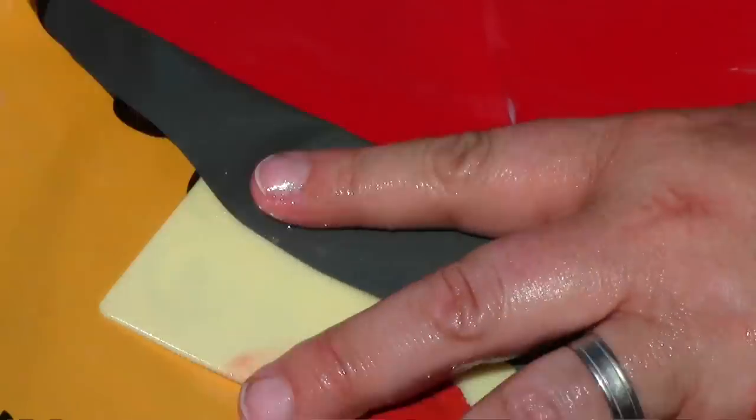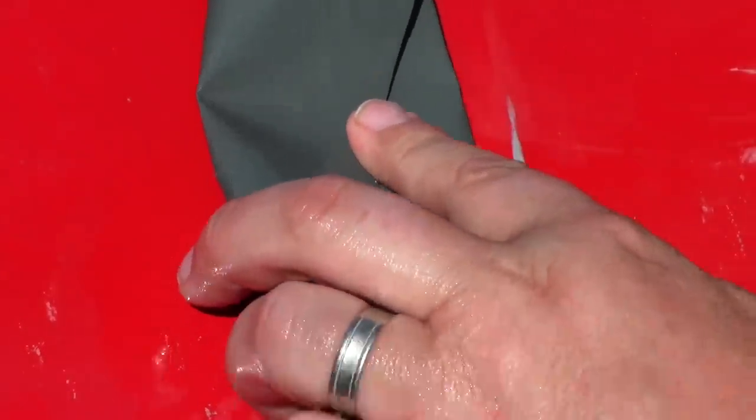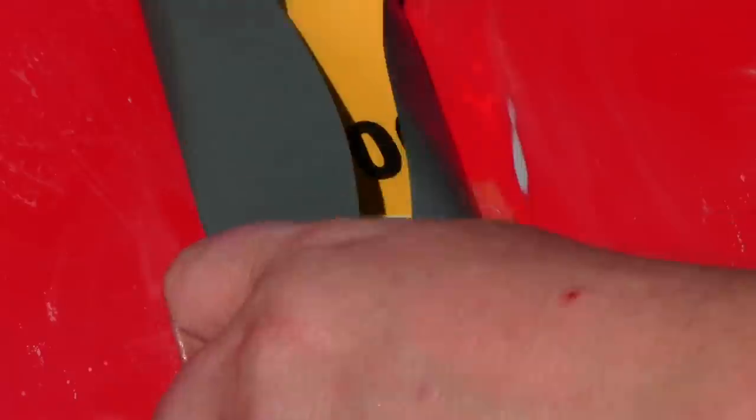So are you going for the same level as the paint, and then you're going to recolor the putty with the paint stick? Correct. So it's not for filling in a divot, it's for repainting. Like if you had a mild scratch, that paint stick would work perfectly. Exactly. But if you've got these big chunks and chips out, you've got to fill it back in to come back to level, or you're still going to see the divot, just a different color.